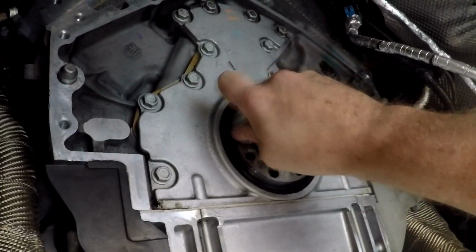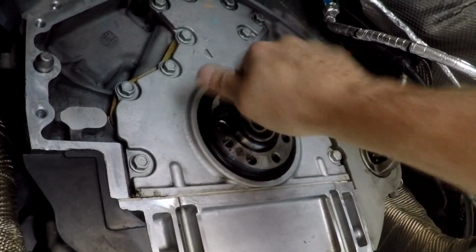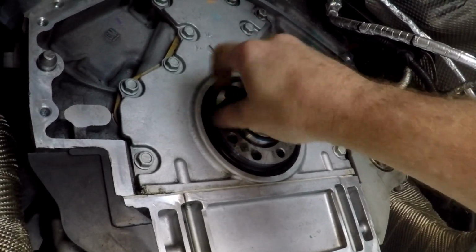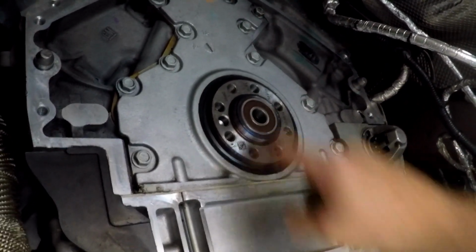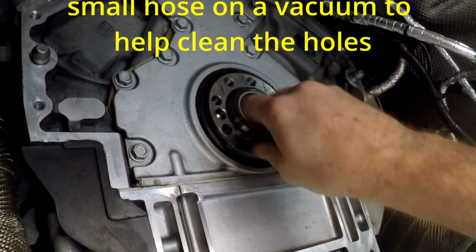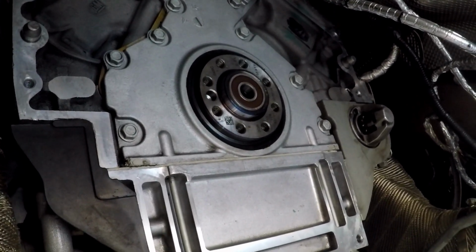Yep, there's about a quarter inch gap between there, so I got more than that on the flywheel, so we'll be okay. These will fit without bottoming the hole. So see, now the bolt goes in nice and easy. We want that because we're going to be torquing it, and we don't want a false torque reading because the threads are all boogered up. So I've gone all the way around and they're all nice and loose now, and that's what you want. So I got to go to the store and get some Loctite 242. I don't have any. Will Permatex Blue work? Probably, but they're calling out for Loctite, so I'm going to go buy it.